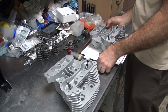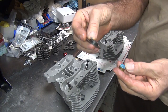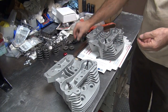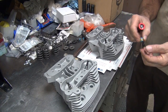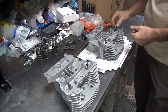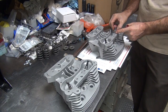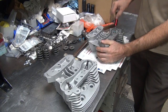I'm going to try putting a seal on and see if it goes on. First thing I check is to make sure it will clear the collar. It fits — barely, but it does fit. You can put these on right now if you want. To keep from chewing up the seal, I just kind of wiggle it back and forth without pushing hard on it — pushing at a slight angle — and it goes right down.